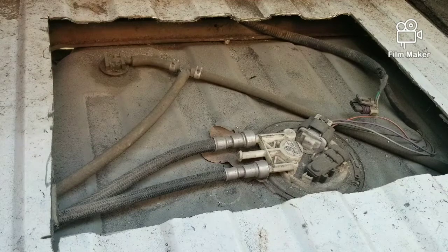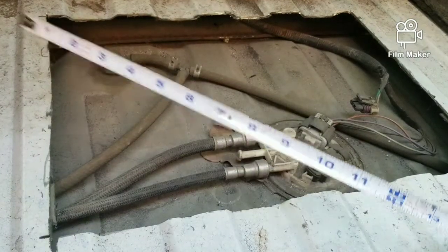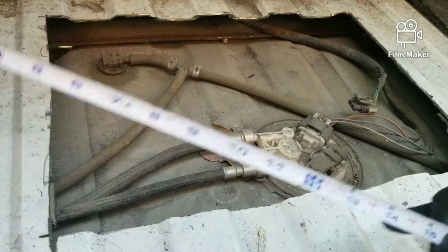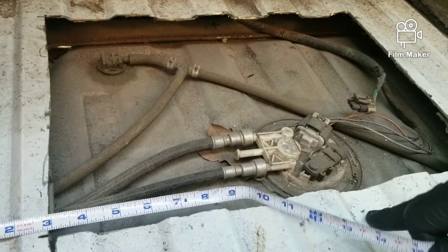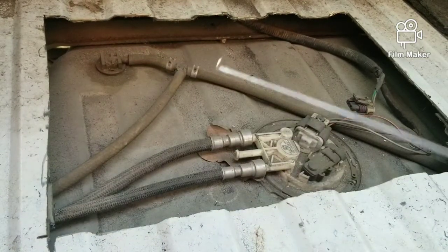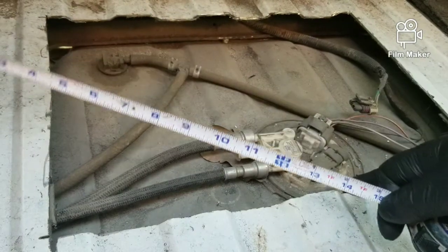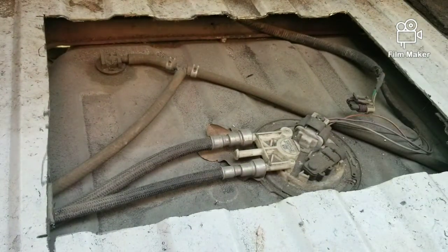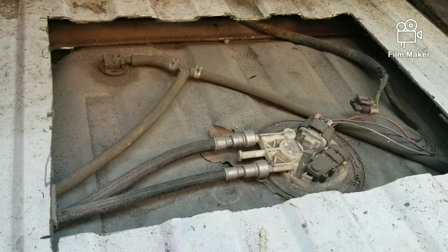And then most importantly, you don't want to mess with the structure part of your truck, because I do load stuff on this truck. So when you cut this here, of course, this is going to affect the flooring a little bit. You see how cutting this in here compromises it. But what I'm gonna do is run some sheet metal up in here and put some self-tap screws in there, and then I can still load my stuff when I need to go to the grocery store or whatever.